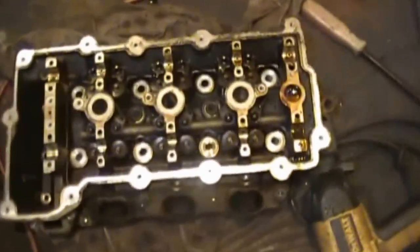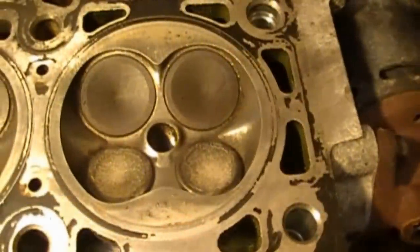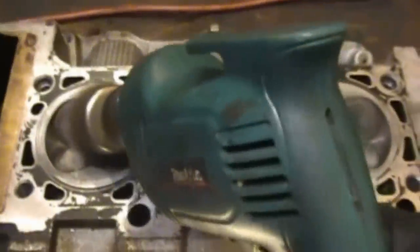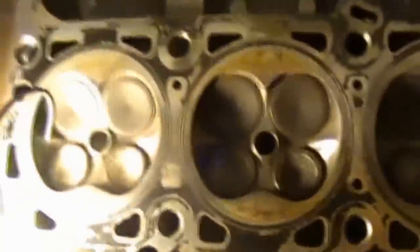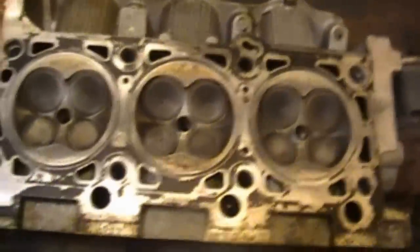I cleaned up the valves pretty good. They look nice and clean. I actually used a drill with a wire brush on the end - it makes it really nice to lightly go over things and get some of the carbon off. I got a lot of the carbon off, so it's looking a lot better. There's a little bit there - I can take a screwdriver and just chip some of that away, or take a piece of sandpaper. Get all your carbon off on your exhaust valves, because it'll make it run a little bit cooler.